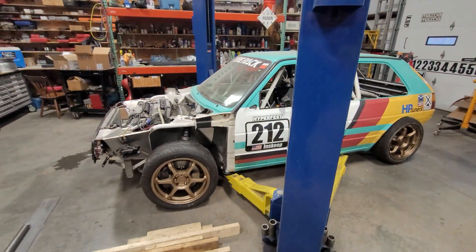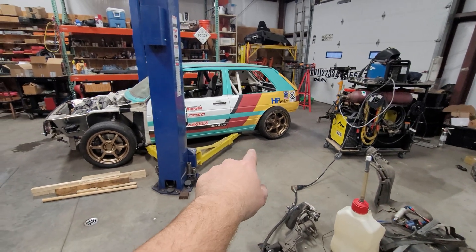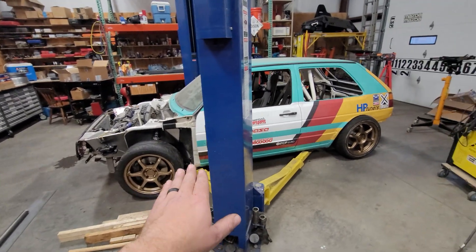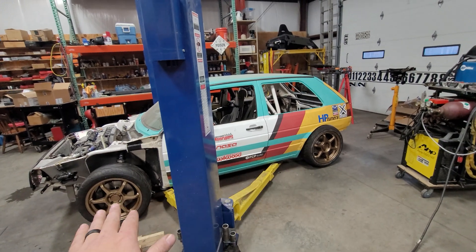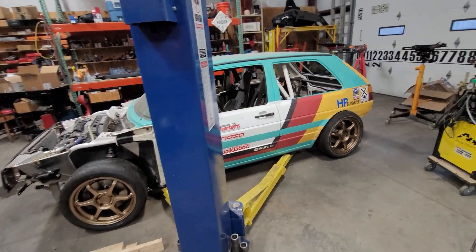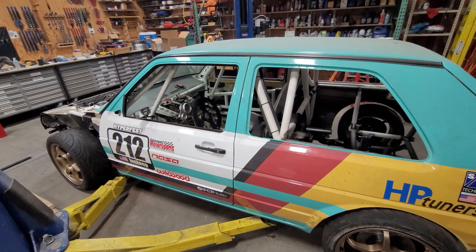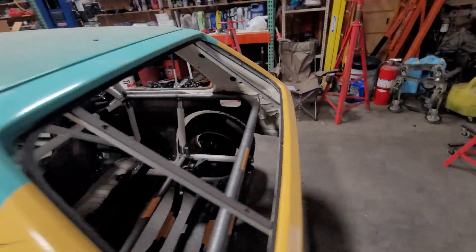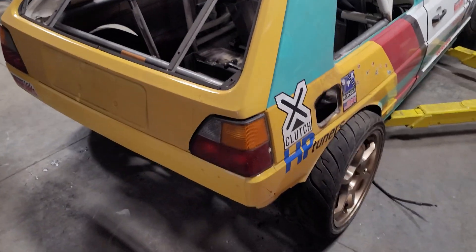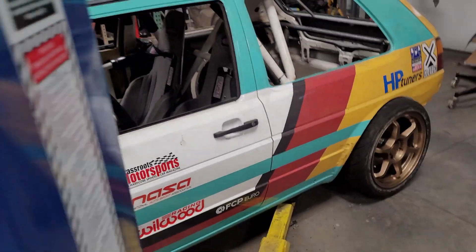That's a 255 front, 235 rear. The pinch welds will end up being about six and a half inches off the floor. The front control arms are about parallel, which is limiting my geometry across the board. I can't go any lower unless I were to raise the front subframe up. I am going to look at some Whiteline extended ball joints for the front — that'll give me a little bit more roll center stiffness and things like that. The view of the camera is in fisheye, so it kind of distorts everything a little bit, but let me step back so you guys can see the whole thing.